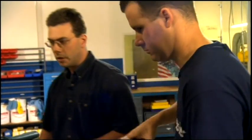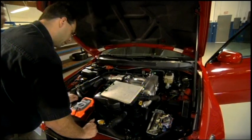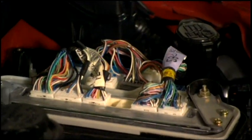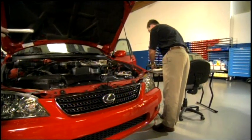Okay, we're going to start with the throttle position sensor and the pedal position sensor. No problem. We're looking at VPA1 right now. I've got 0.47 volts. So we need cam timing signals so we can replicate the information needed to get the tach to work once we get the new engine in.